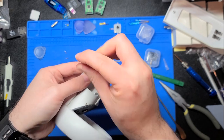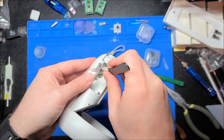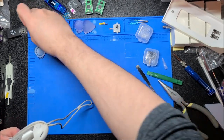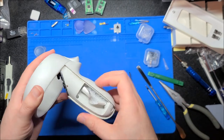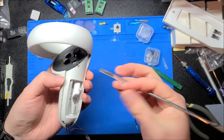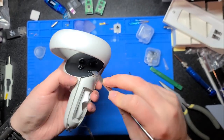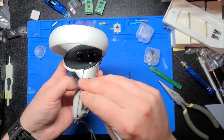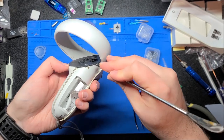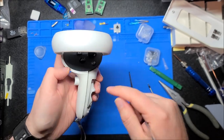That's not the case once we start getting inside. Hopefully she and/or her son doesn't mind that I accidentally tore the sticker — this is a very super fiddly repair. Now next up, you're actually going to need a spudger of some sort. You need to get underneath this plastic disc without torquing it up completely — don't pry from just one edge. You want to go around the edge; there's both adhesive and little plastic pegs that friction fit.